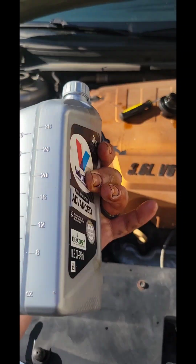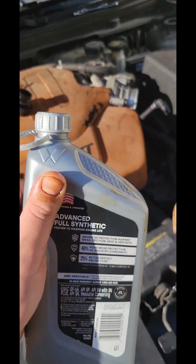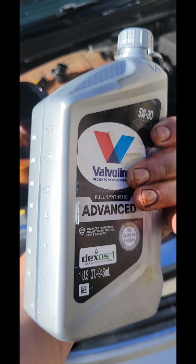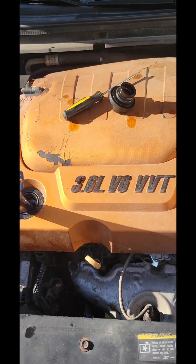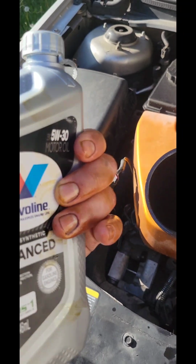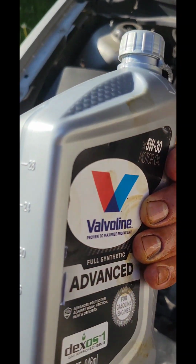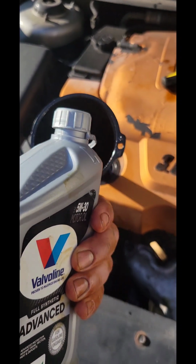By the way, the amount of oil that this car takes, which is 5W30, which I pointed at earlier in the video, is one whole 5-quart bottle, and then a 1/2-quart bottle of this. And also, as a tip, with this engine, it's reliable as long as you keep changing the oil on time, but it's also a good thing to save this other half and put maybe like a 1/10 of a quart in every 500 miles or so. Keep it topped off. Mine needs that. Just keep her running good.